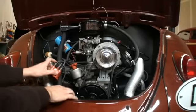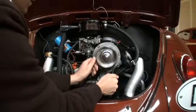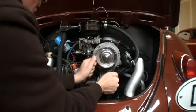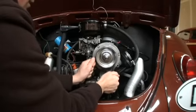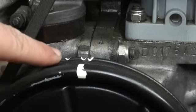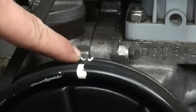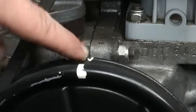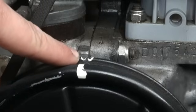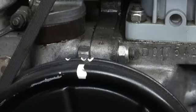There are notches on your pulley. Start moving your fan belt to get over to number one — alright, here are my notches. If you look at the pulley I have here, I have three notches: one, two, three. This first notch is top dead center. The second notch is 7.5 degrees before top dead center. And this third notch is 10 degrees before top dead center. Most bugs, depending on the distributor you have, will time at 7.5 degrees before top dead center. That's where the manuals tell you to time them and that's what we abide by.